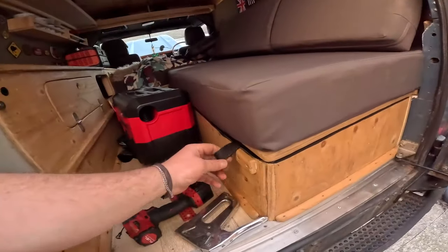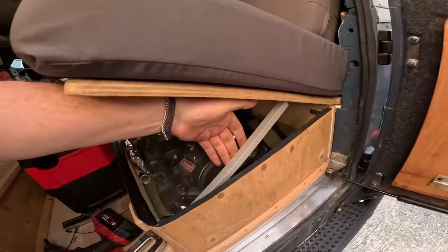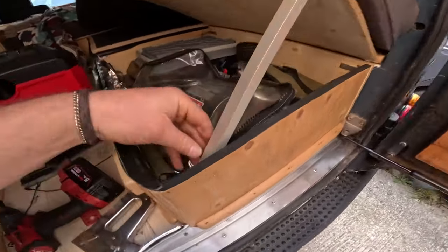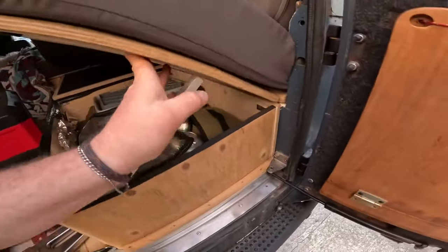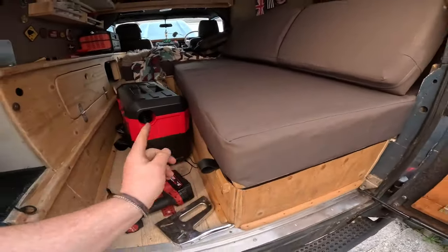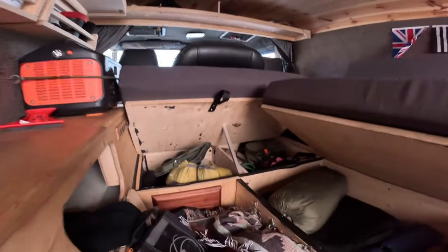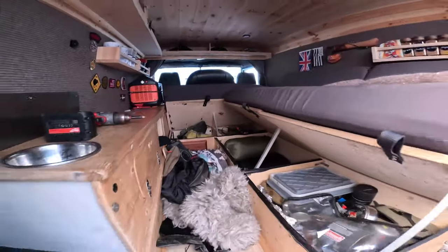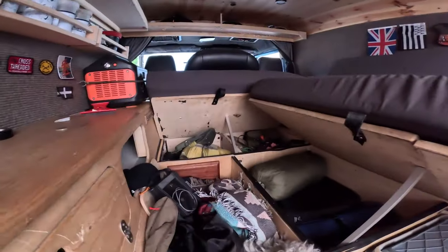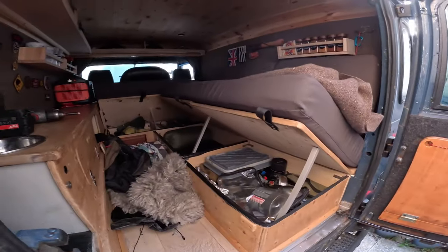It's getting pretty late in the day and I'm trying to speed up. I've got some aluminium tubing and I've made a prop rod system I should have done ages ago. I've used a surfboard strap screwed into the bottom so you can lift the hatch up easily — usually you use your fingertips. There's a rod on a little pivot and a screw for it to sit on, which holds it up nicely so you can use both hands inside, then push it back down when done. I've done it for all three drawers. There's a little strap handle on each one and a pivoting piece of metal to hold it up. This was a request from Sophie because it's been so difficult to go in one-handed. Took about half an hour. Much, much better.